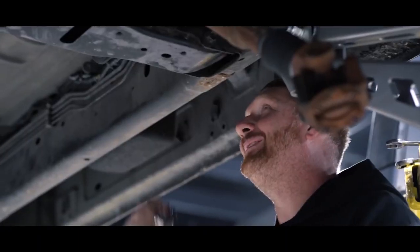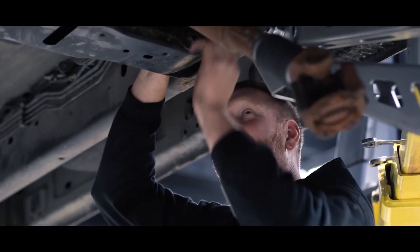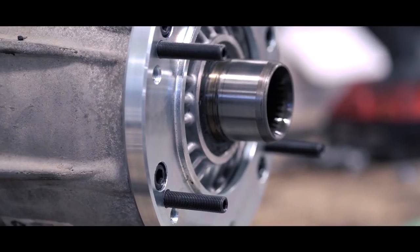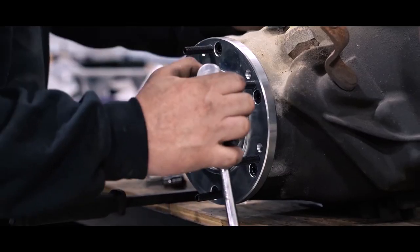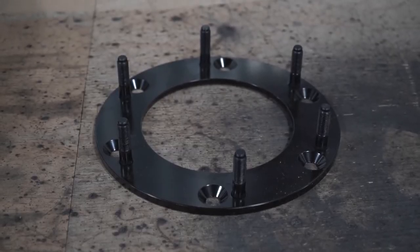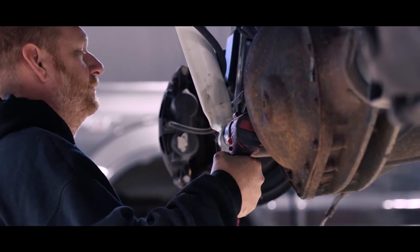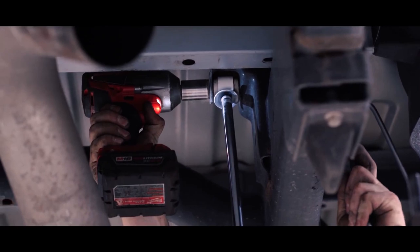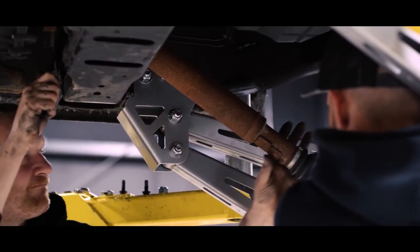This usually occurs around six inches or more as far as lift kits go. A good lift will correct for this driveline angle in a few different ways — some include a new drive shaft designed for the increased angle, or they may drop the transmission and transfer case assembly down, which is a pretty hefty install process. Another pretty common solution is to clock the transfer case, where the transfer case output gets rotated down closer to the ground, which decreases that drive shaft angle. That's probably one of the more common ones you're going to see.